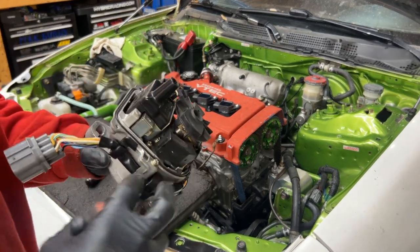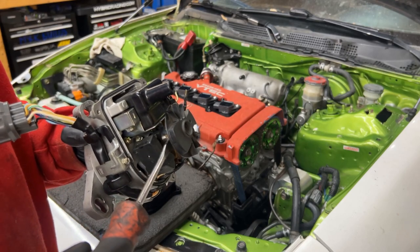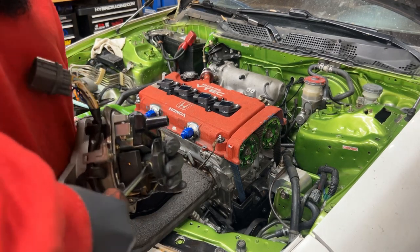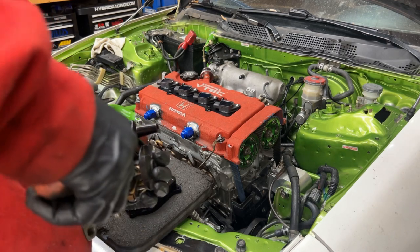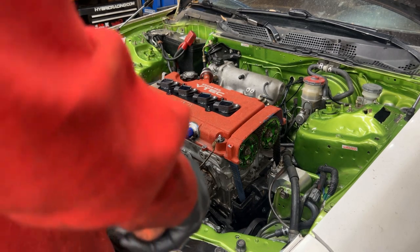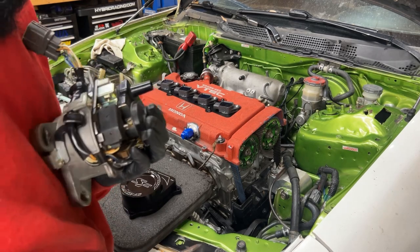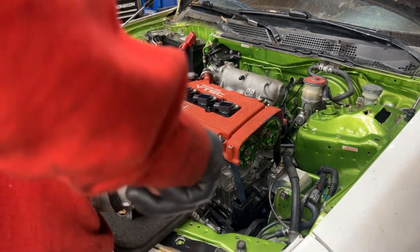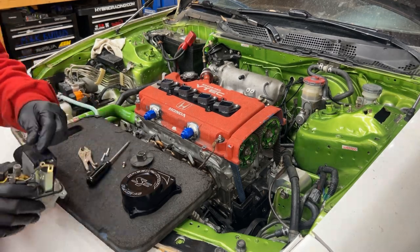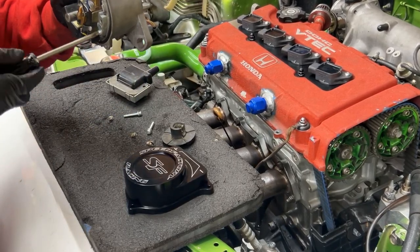All right, so I went over there and put a slit in there with the cutting wheel, so I can put a flathead on there and try to get good leverage on it. It's coming, but it's very tight. Someone tightened it up way too much, or it's seized in there, but it's coming. Also, we want to take this out too. Ignition control module.